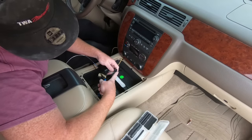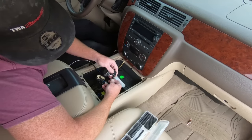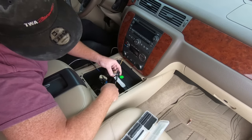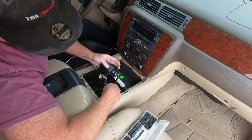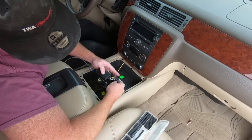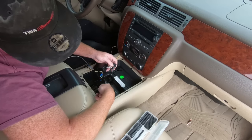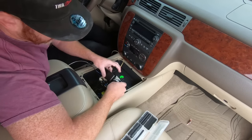So at this point you can see I got the plug back on, we are wired in, and everything is soldered and taped. I was able to use some heat shrink because I was able to go a little further down, so there's heat shrink under the tape. I just taped it up to make it look more factory. And if you ever want to take this out, you can honestly just chop this off and tape it up and you're good.